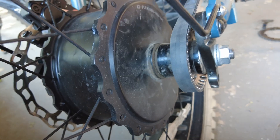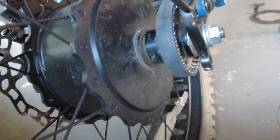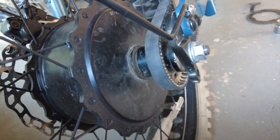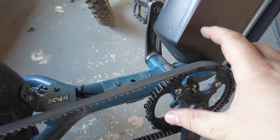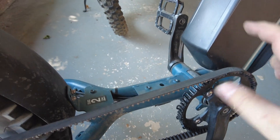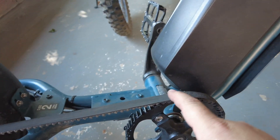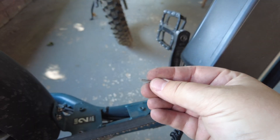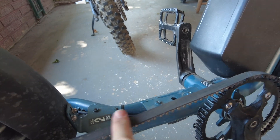With the rear sprocket in position and the front sprocket mounted on the inside of the spider, that gave me perfect alignment on the whole system without any additional adjusting needed. If you're doing this yourself, keep the spacers from Super 73 in the exact order they are, or tell your bike shop to do the same. The last step is to attach the belt to itself: the male/pointed end faces toward the front of the bike and the V points toward the rear. Slide the provided rivets through the holes and use the rivet tool to fasten the belt together.